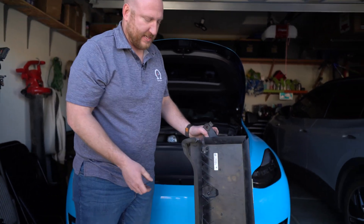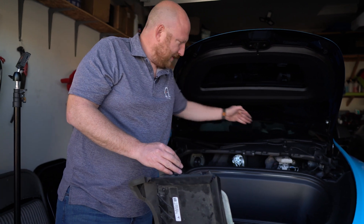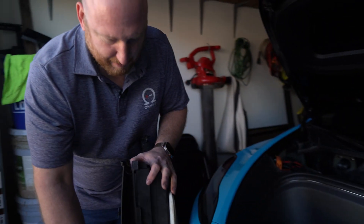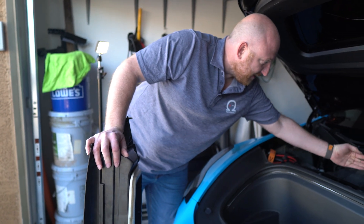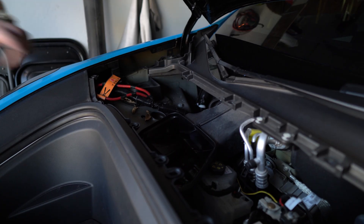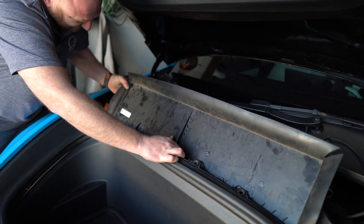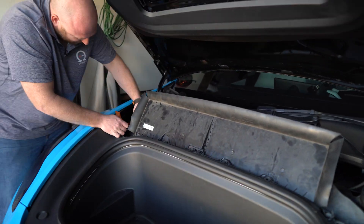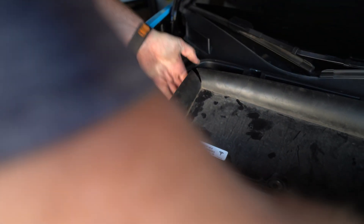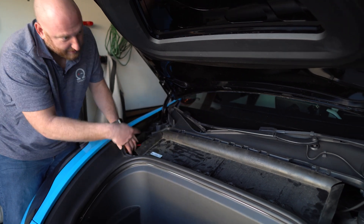This is going to be the opposite of the way we took it out. Stay on the passenger side primarily, and you're going to put it in at an angle and then shimmy it underneath this lip. Once you get it far enough down so that this plastic lip is in front of the other plastic, you'll be able to rock it back down, and then this seal will seal right inside the air intake. Be cautious with the wire looms again — make sure they're on top of the filter and not getting caught underneath. Make sure you secure this side with a little pressure to ensure it seats into that intake. Then reinstall the two 10 millimeter bolts.